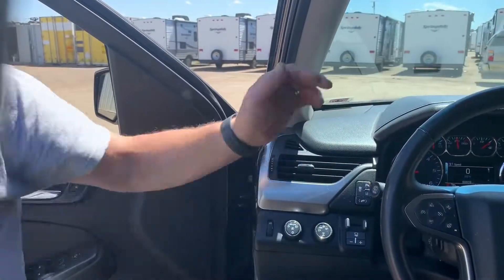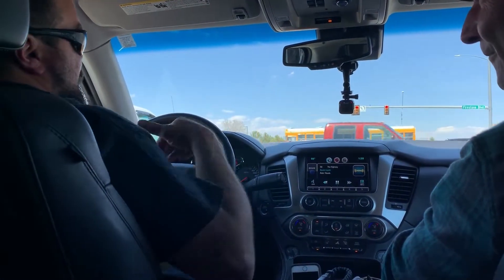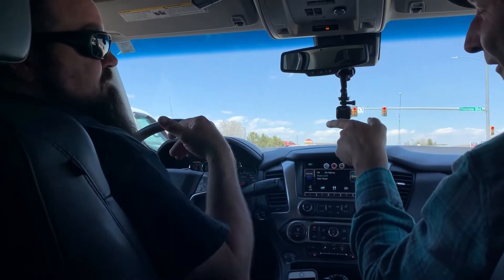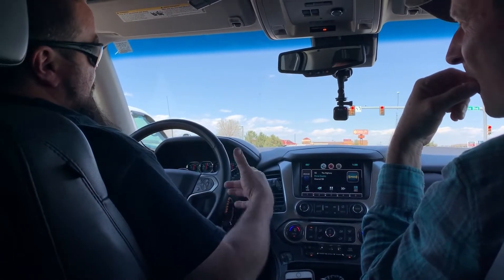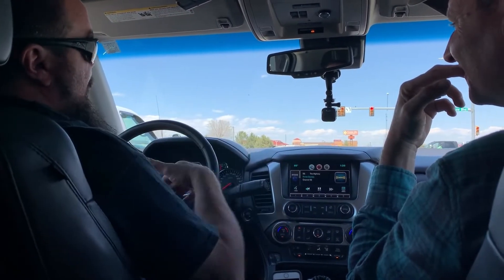Well, let's get heading down because we've got to get kids from school. If you use the trailer brakes to slow you down as you're coming down the mountain, you just squeeze the trailer brakes to slow you down instead of using the car's brakes — so I'm not even using my brakes. You won't have to use your brakes as often. If you really need to slow down, you need to use them. But if you just use this, you can use just the trailer to slow you down, which is a lot safer and easier on the car.